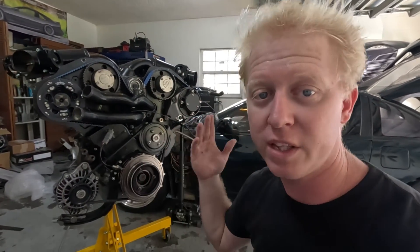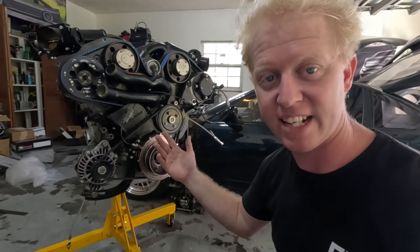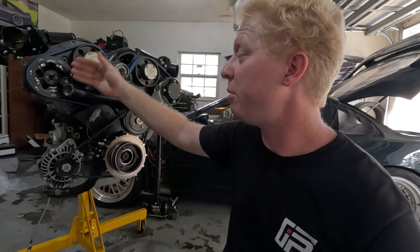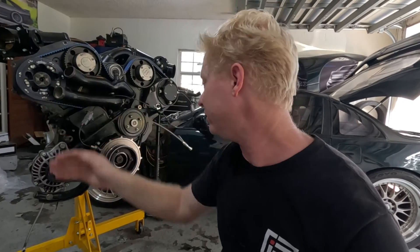If you're familiar with the VG30 and the ATI damper pulleys, my race damper from ATI has always had problems throwing the power steering belt. The pulley on the ATI damper is not aligned properly with the power steering belt pulley. It will work for a short period, but the moment I go to do a first or second gear pull and it slams through that gear quickly, it throws the belt. If you've driven one of these cars in twin turbo form without power steering, God help you — it's not easy and not fun at all.